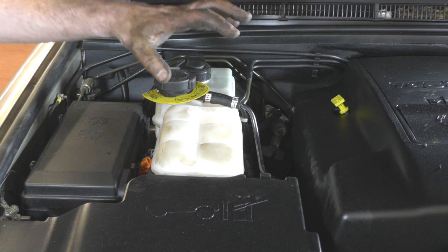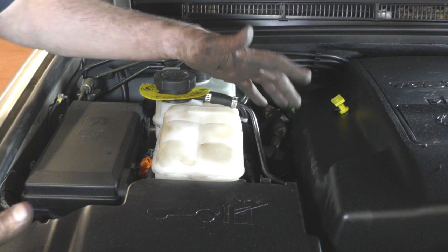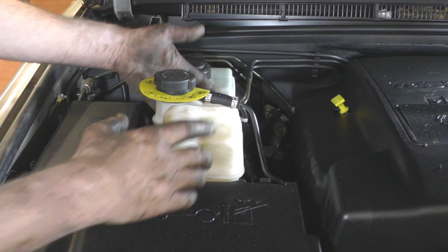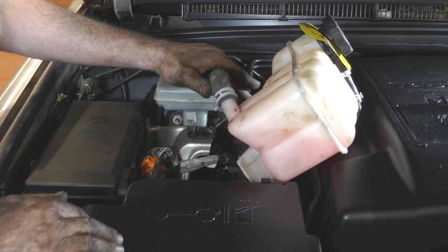These are the plastic pipes I talked about — if they are old and original, you really ought to take these off rather than leave them on, because if you hold it out of the way there's a chance they'll crack. We've replaced these fairly recently so we know they're okay. The header tank is just clipped in, so you lift it up at the back, unhook it, and move it out of the way — that gains access to the top of the turret. There's also a wiring loom clipped into the top of the turret — just a push-fit plastic connector — so make sure that gets out of the way before you start taking it to pieces.